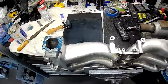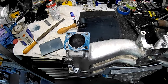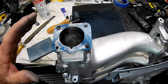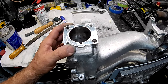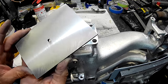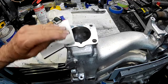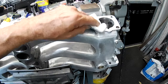The second manifold face has real solid contact in some areas but no contact up through the middle — but it might come down quickly. Both are now at the same stage, so I'll fix some adhesive sandpaper to our nice flat piece of mild steel and use that to clean these up even further. Nothing's easy, is it guys? Starting with 120 grit — be very, very careful and gentle when doing this; keep the block nice and flat, don't rock it at all.